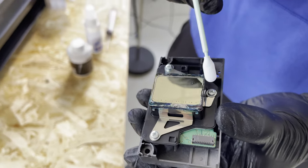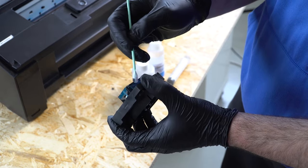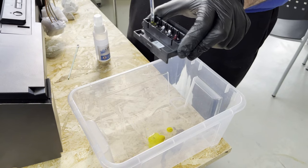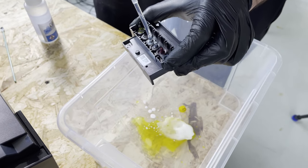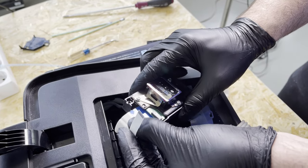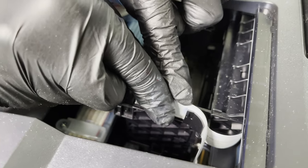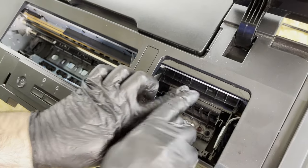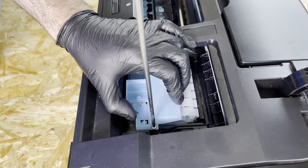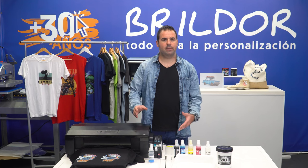Carefully release the flex cables all at once. Use a cotton bud to clean around the edge of the print head, which may have dried ink on it. Now use the syringe with cleaning solution and flush it through each of the nozzles. Place a bucket or container underneath so you don't make a mess. Press down, but not too hard — you will see residue come out followed by the cleaning fluid. Once you have finished, reassemble the head ensuring that the cables are correctly fitted. Put the screws, the covers and the dampers back in place. If there is still no ink showing after trying all these methods, you should probably replace the print head.